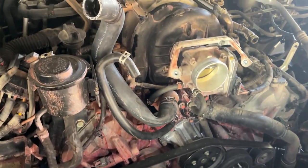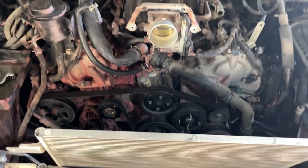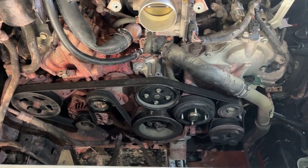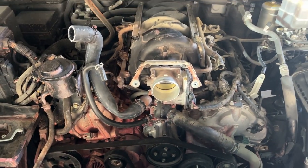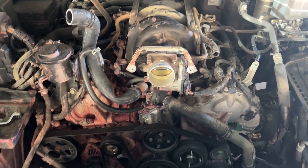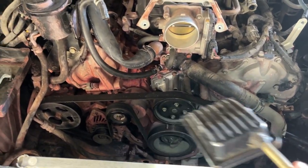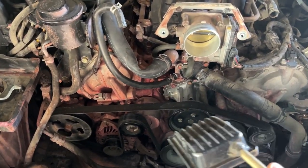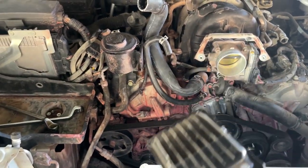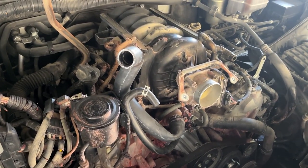This is the best view for Nissan Patrol owners to understand exactly what to do. There is an oil filter over there. When you are changing the radiator and thermostat, it's best to change everything together at the same time — the tensioner, the water pump, all the big and small hoses — so you don't have to return to the same point again next year.